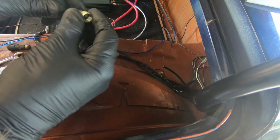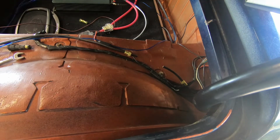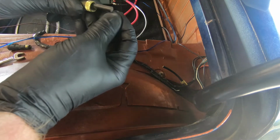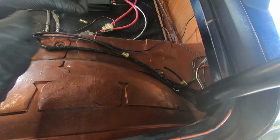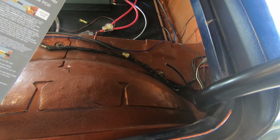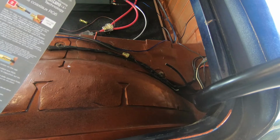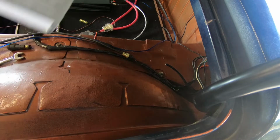Put the end caps on first. The instructions are on the back, so put the end caps on. Then you simply slide an O-ring over the coax. Do that on both sides. Okay. Step 3, I'm using pliers. Firmly squeeze opposing piercing fingers 2 at a time. Continue squeezing until all fingers form a smooth circle that the cap can easily slide over.